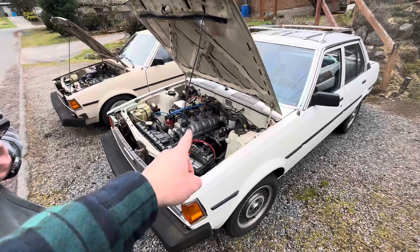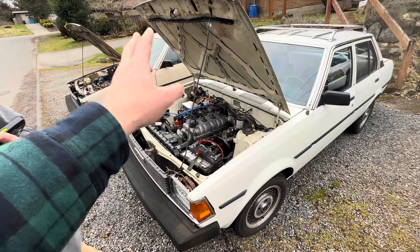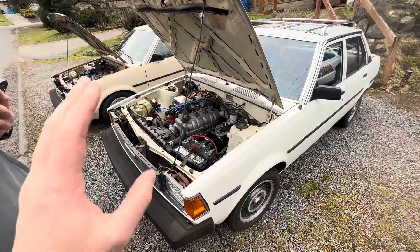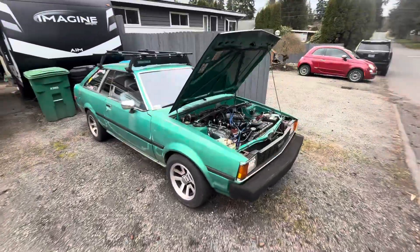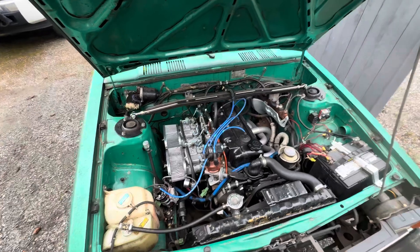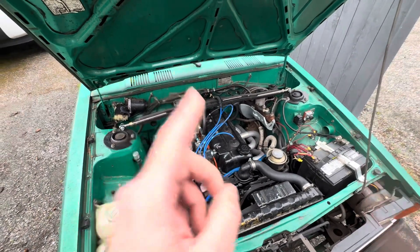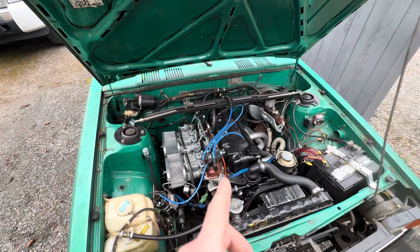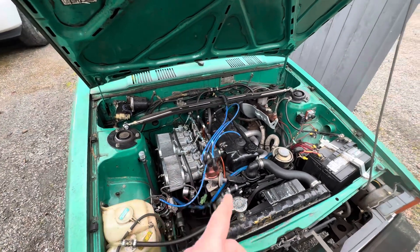It was definitely a lot of time — I probably had 40 hours plus into the engine rebuild. I hand-polished the crankshaft journals, cleaned everything up, put it back together, et cetera. Over here is the 1980 Toyota Corolla liftback. This has a 3TC we rebuilt in 2020. Internally: stock crankshaft, stock rods, a lot of ARP hardware, 10.5-to-1 Wiseco pistons, bored out to 87 millimeters — stock pistons are 85.5.